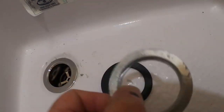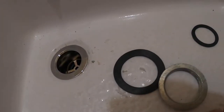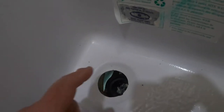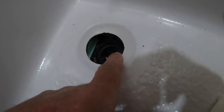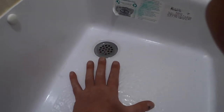Go underneath, put the washer up on it, put the nut on it, put the bottom washer on it, and screw the bottom on. I've scrubbed it down and cleaned it with alcohol — good rubbing alcohol. Your ability for this to be leak-free is totally dependent on how clean it is when you start. I've cleaned that and we're ready to assemble.